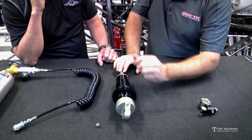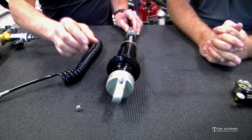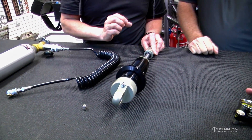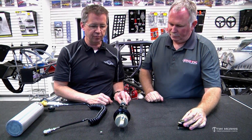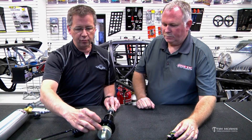The pressure is critical — you need to check it and keep an eye on it. We'll show filling it and how to check the pressure in just a second. We get this all the time at the track: the car acts strange and I ask when they last checked the canister pressure on the shocks, and they say 'what are you talking about?' There's not a lot of room in here — it has a lot of mechanical parts, oil, a piston, and nitrogen. There's a very small reservoir, and an O-ring seal and Schrader valve where the slightest leak can pull all the pressure out. It's imperative that you check it. I tell all my customers to check it every morning as part of their start-of-day routine, because overnight it can leak off and then that shock is not going to act right.